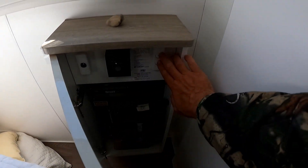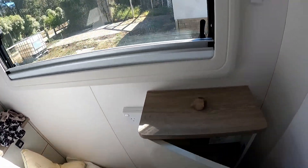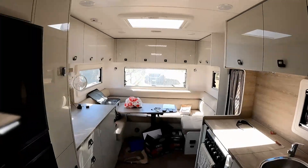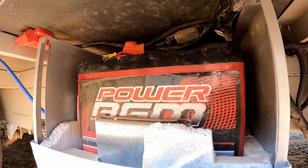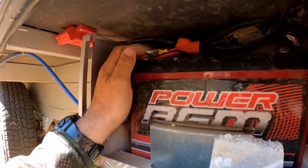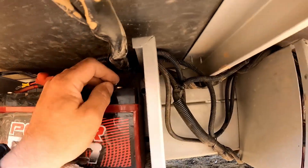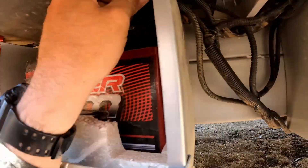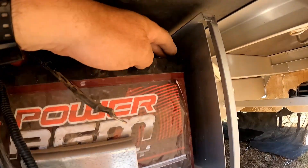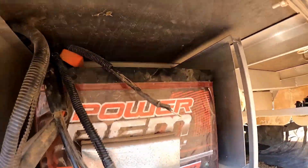The first stage is going to be to turn off the power, which on mine is just there — so that's turned everything off. The next stage will be to disconnect the power from the batteries, so both terminals need to come off. I've had a little shuffle around with the cabling. I've brought all the positives to the left battery's positive terminal. All the negatives — just the link on this battery going to the other earth — and I've pulled all the earths together on this terminal of the right battery. That way the BM Pro will see it as one big battery, and all the loads are on the same terminal, which is really important. If a load goes onto the other terminal it won't be measured — it does have to go onto the shunt.